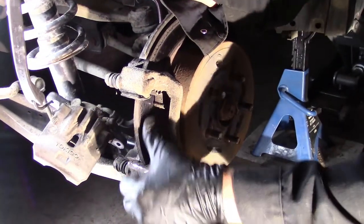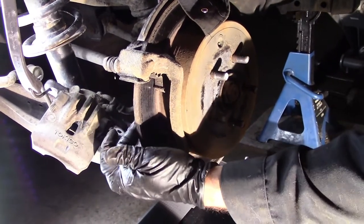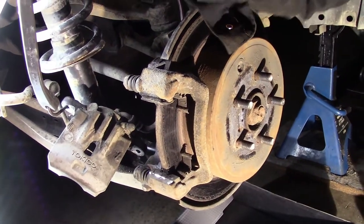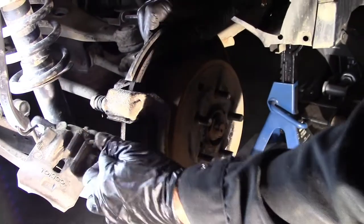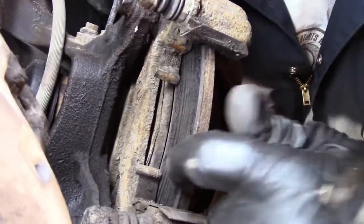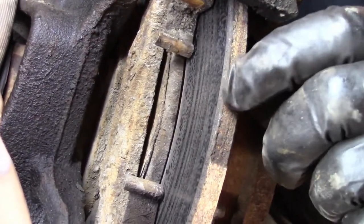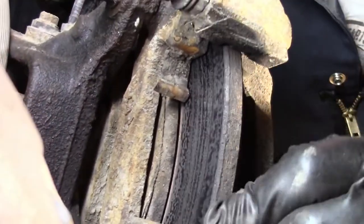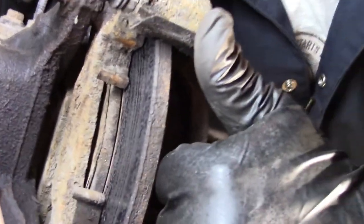But on this side, it's smooth. So that's also why it's always the back brake pad that wears first, and so it's very misleading. If you look from this side, it's smooth, but on the back side, if you can get in there, can you see those grooves right there? Any more in there? Okay, so you see those grooves right there? So that rotor is damaged. It has grooves in it. Time to get it out. Let's change it out. We're here.